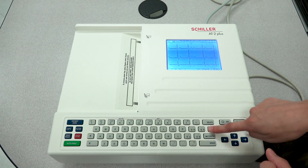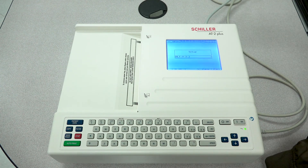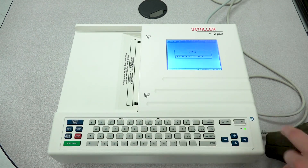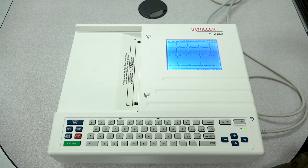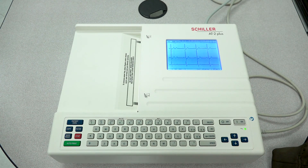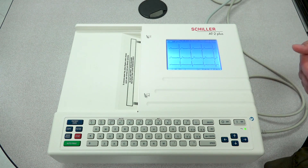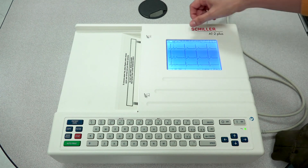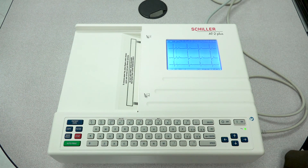Changing the date is very similar. Instead of Alt-9-1-1, you press Alt-9-2-2, then enter the format of the date. Today is the 20th, so 2-0, then the month which is 0-4, then two digits for the year which is 2-0. Your unit will beep confirming it has taken the date. It's very important to keep the date set correctly because if it's incorrect, your patient's age on records will likely be wrong. Be sure date and time are set correctly to avoid that. I think I've covered the most common troubleshooting tips — if you have any questions, please feel free to reach out to Schiller Americas. This concludes our demonstration, thank you.